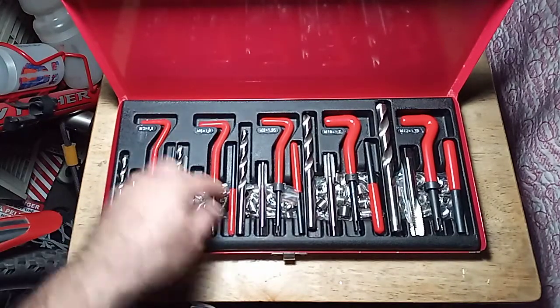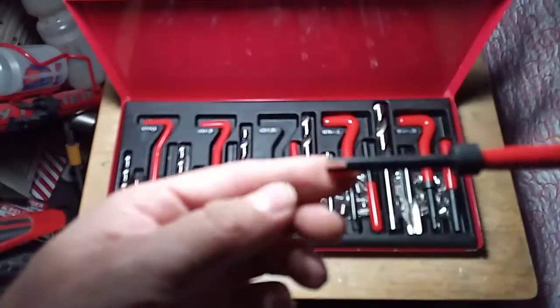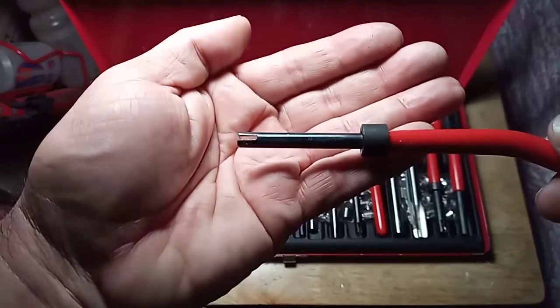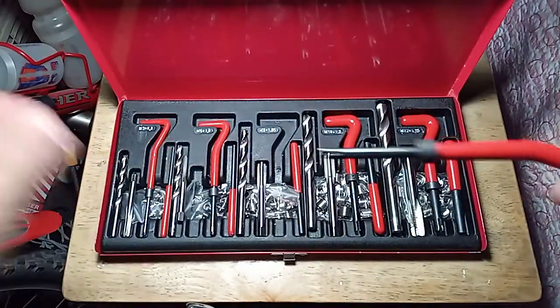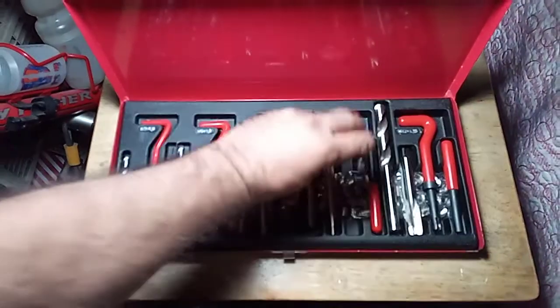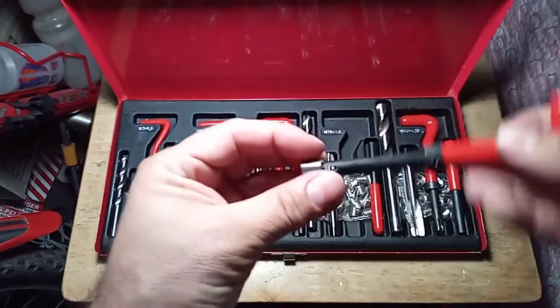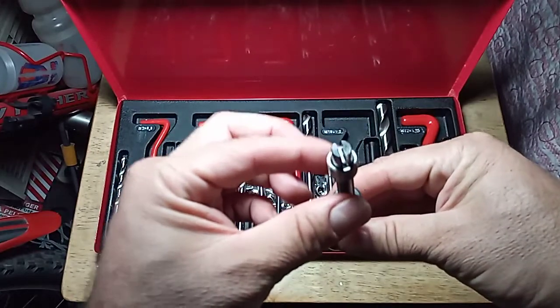And surprisingly, all of the other ones had the same thing. On the big ones though, I just went ahead and fixed the slits. So I basically ground those down so that the inserts will not get stuck. Actually, I had that happening even on the big ones. As you'll see now, they just work pretty much loose.